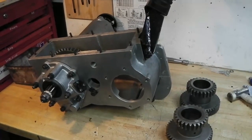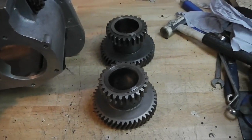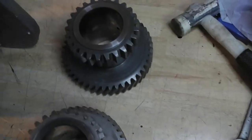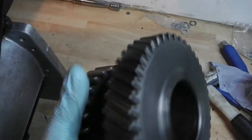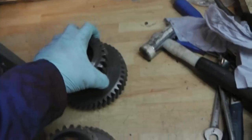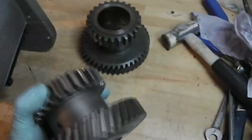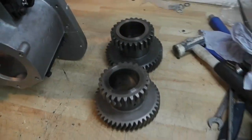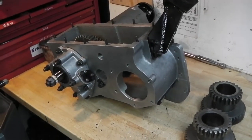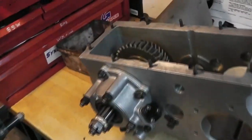Hi folks and welcome back. I'm just at the stage of finishing off the transfer case ready to fit - bolting the mounts on and I've got to select which intermediate gear I'm going to use. They've both got pros and cons; the bore of one is slightly better than the other. This is the one that came out of this transfer case from an ex-military vehicle, so naturally it's been smashed in and out of low range, as you can see by the chips in the low range teeth. The other one has obviously spent less time in low range and been treated better, but the bore is better. To determine what I'm going to do I'll fit them both in the transfer case to see which I can get the end float set correctly with, and which has the least backlash.